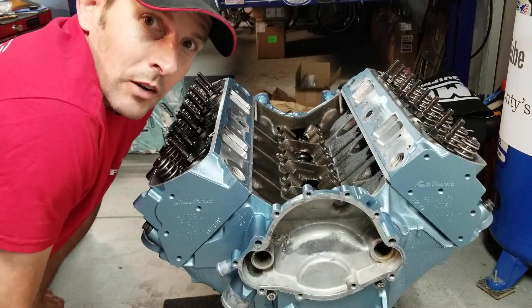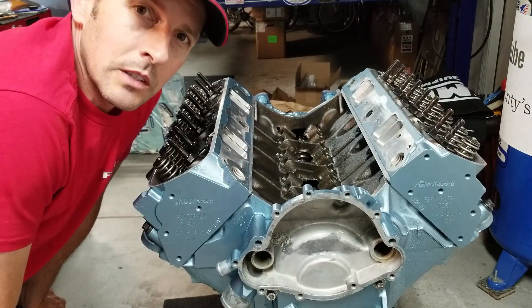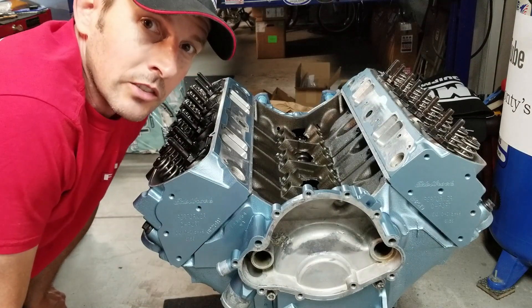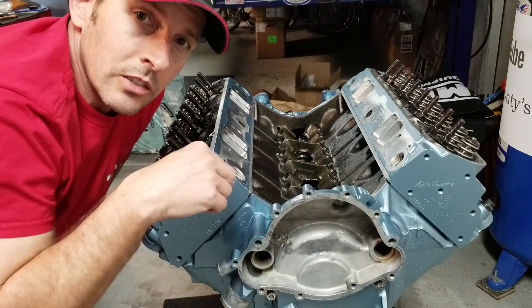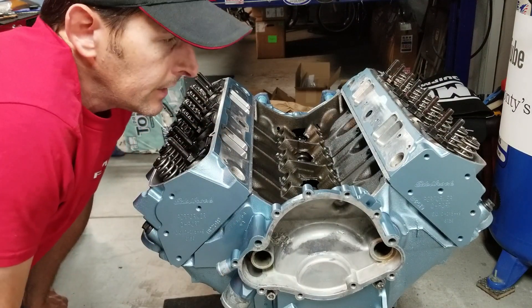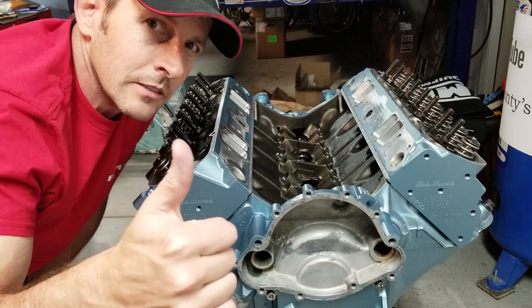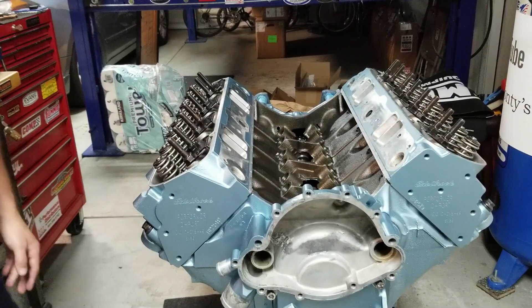This concludes episode 12. Everything went seamless — I hope you learned something, especially about how to clean your gaskets before you put them on and those head surfaces. For break-in, we re-torque after our first heat cycle, then after the break-in oil change at 100 miles, and then I'll re-torque them again. This is getting fun. Thanks for hanging out. Subscribe if you haven't, and you know the drill — building fast, driving faster. See ya, I'll see you next time.